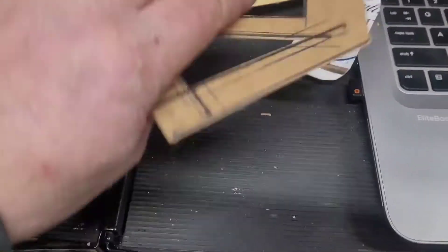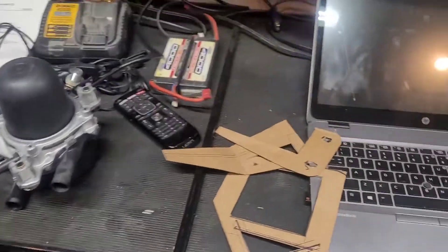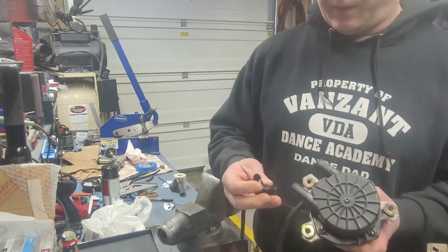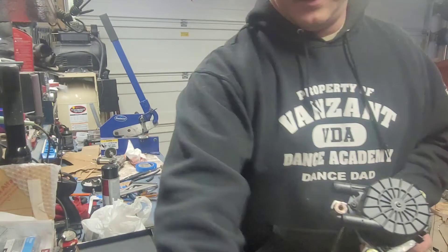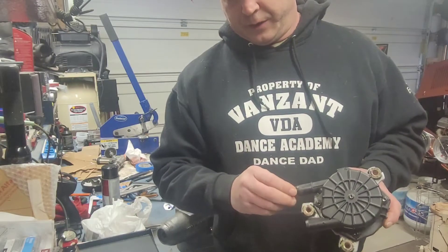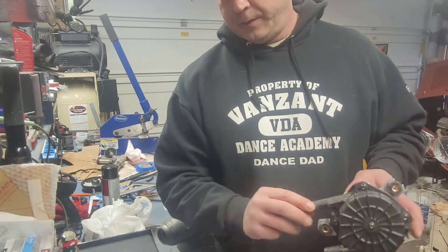I did make a cardboard template — here are the cardboard template pieces for mounting the pump. The pump will mount on the bumper bolts on the aluminum solid bumper mounts that I made. This here will be the inlet, and I want to adapt a 3/8-inch MPT thread to dash-10 AN, so I've got a 3/8-inch MPT tap and I'll tap these ports.